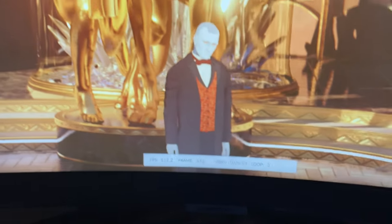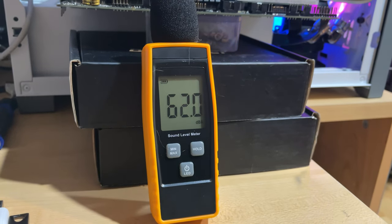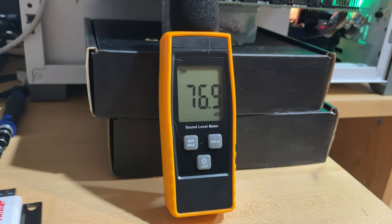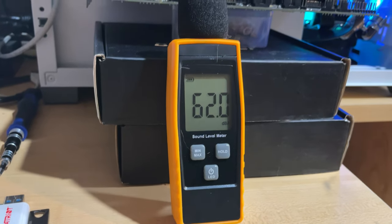On loop number three it's kind of settled around the 60 Celsius mark, around 500 watts, 65–70% fan speed. I don't see water cooling this being necessary unless you're space-constrained. Let's actually see how noisy it is — 62 dB there at 70% fan speed. So it's definitely not inaudible. Our final numbers look like 60 Celsius, 490 watts, and around 65% fan.